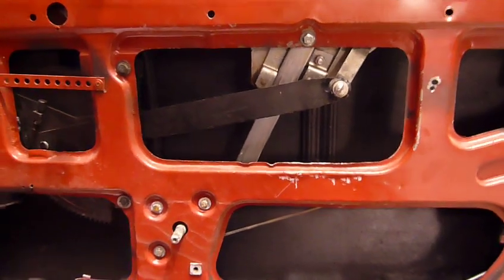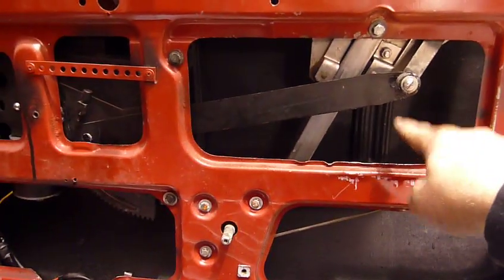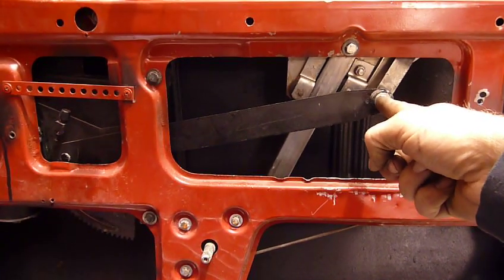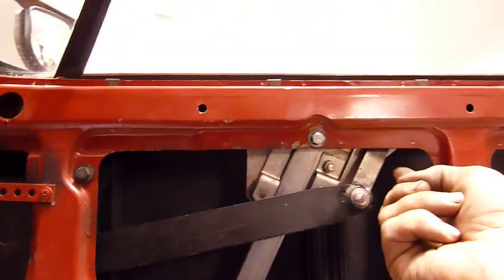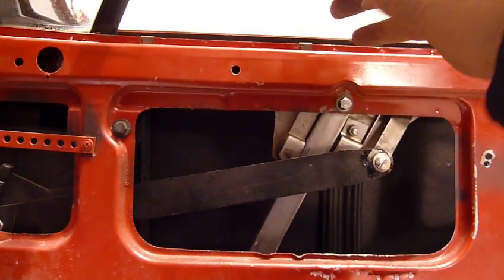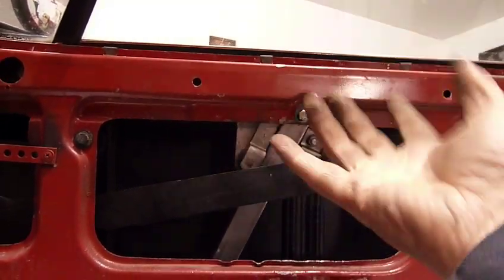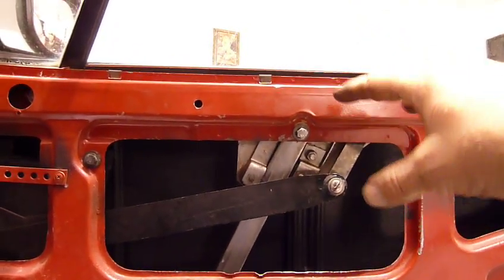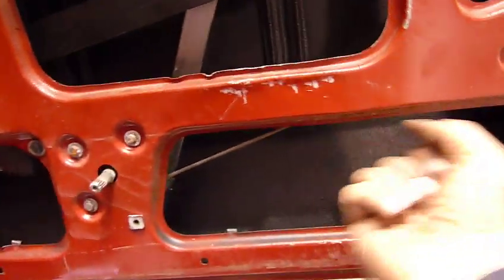To get the regulator out: if you can get this to move, get this straight — right now it's in the up position, you want it level, just down like two inches. If it's all the way down or all the way up, it's going to be a pain. Get that straight, take out this screw, then take out this 10mm bolt on the bottom right here. The regulator will come down once you get this screw out. Then up here there are two 10mm bolts that bolt the glass to the regulator assembly. You're probably better off to do the glass first — take out those two 10mm bolts, put the glass back up, and secure the glass so it doesn't fall down, because it will. Then go ahead and take this piece out first — it'll drop down sideways, and you can pull it right out through the bottom hole.